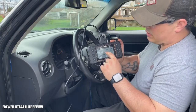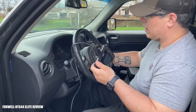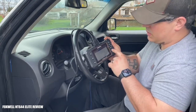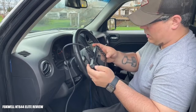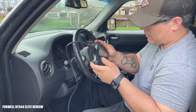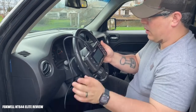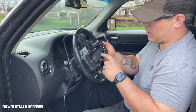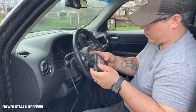We have a few different options here — we have auto VIN, so we're going to try that and see if it works with this car. I'm going to key on but not start it, then use the auto VIN acquisition. If that doesn't work, there's a manual VIN input option directly under it. We're going to do the automatic VIN — it did it pretty much right away, which is awesome. We press F3 for yes, and it's going to do a bunch of system checks to verify all the different modules. It gives the model year, body type, and for the Jeep Compass platform it could be a Compass or a Patriot, along with the VIN number.